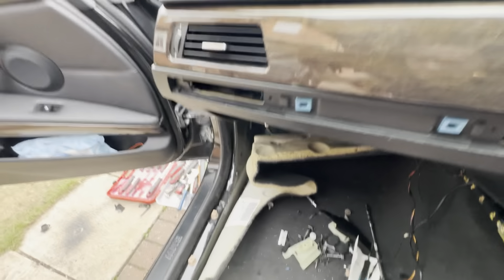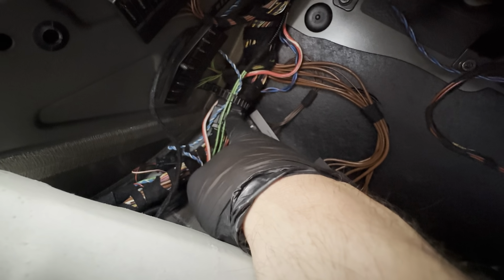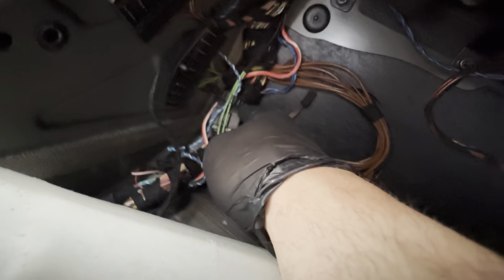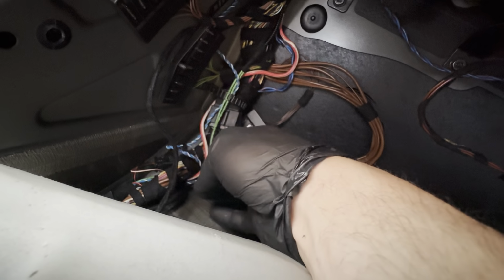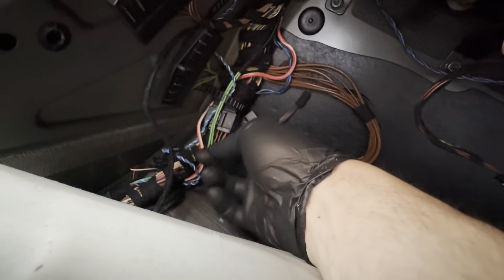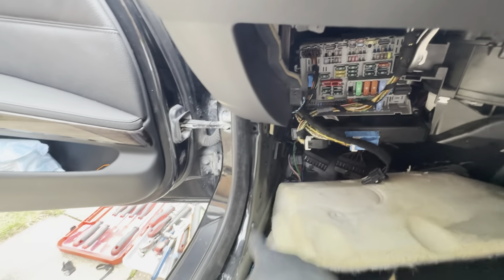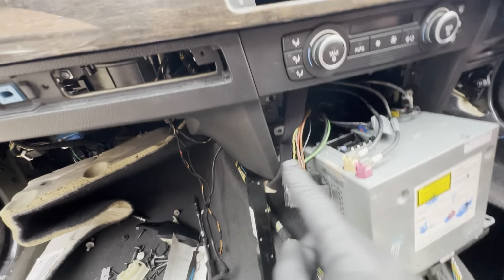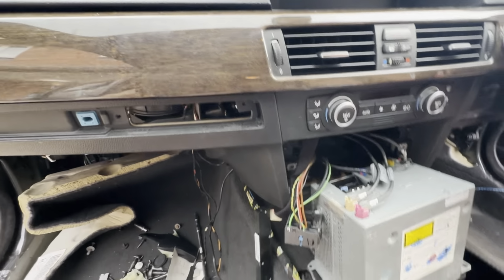We then spoke about moving this big connection block across, because it was different on the new loom versus the old loom, which we did. So I literally just chopped the wires, moved everything across which was necessary. And these wires are CAN interface, ignition wire, and the main power wire for the iDrive, for the CIC, CCC head units. So it runs along here, up here, into there, and right into the back here. So it's really quite straightforward. It's just those wires on there.